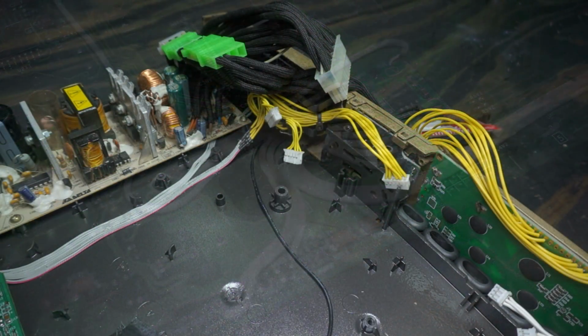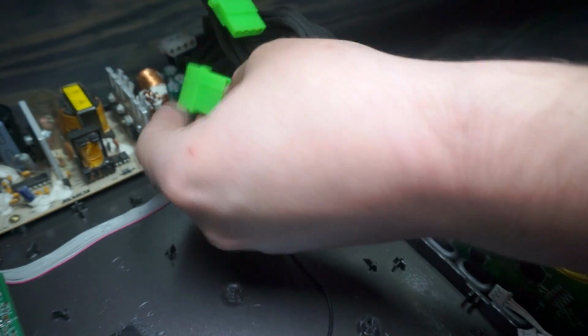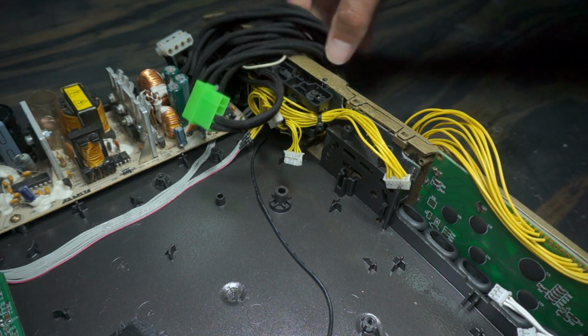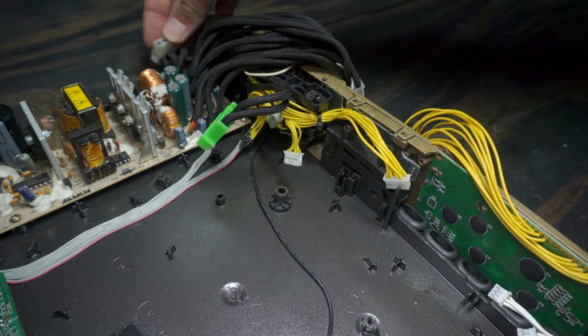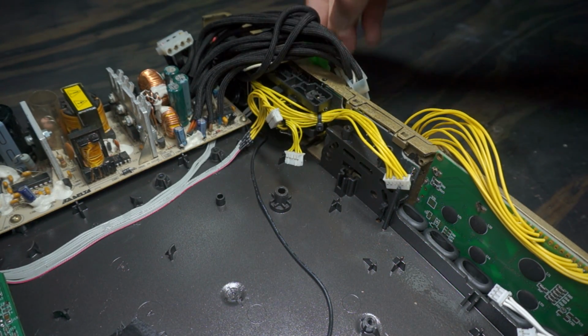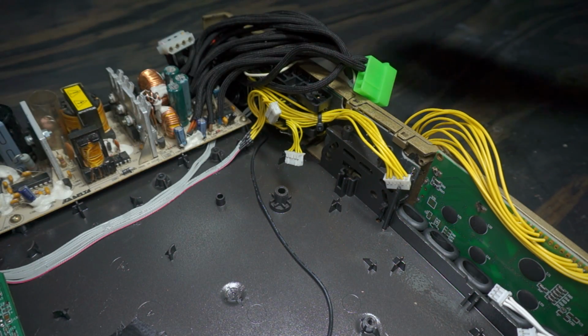Moving to the bottom shell, I have UV green Molex connectors, which power my temperature LCD and my IDE to SATA adapter. I shortened my power supply cable just to get rid of unneeded wire and make it clean. If I had a Molex crimper, I would have matched that connector as well, but I don't. From here you can see my wiring that all goes back and forth to my switch, which I mentioned earlier. The switch is between the DVD dongle and the controller port for functioning normally.